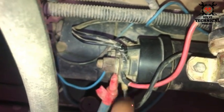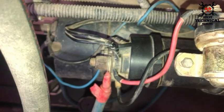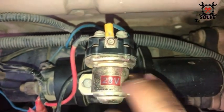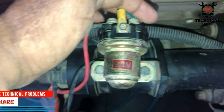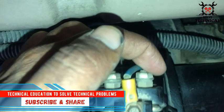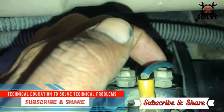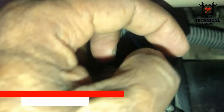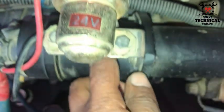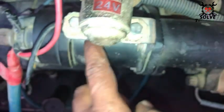This is one side of the starter wire. The opposite point of the relay engages when the upper point — the yellow wire with the yellow thimble — is energized from the module. On pushing the start button, the current is shifted to this point, and from this point the current goes to the start solenoid. You can see this wire is connected here on the start solenoid.